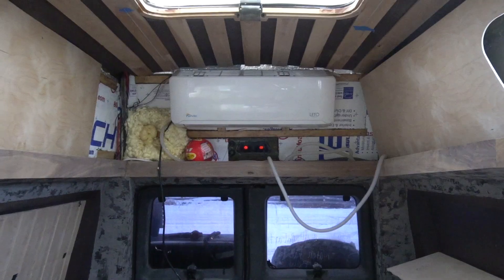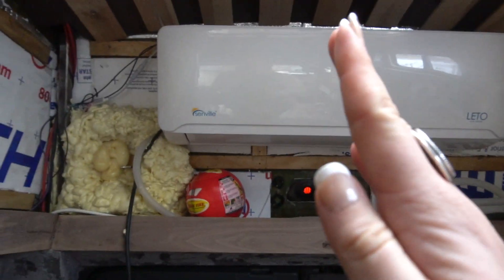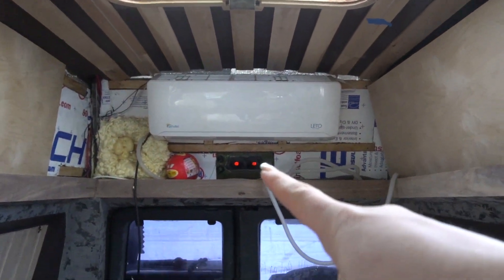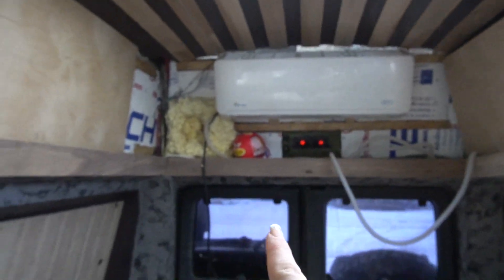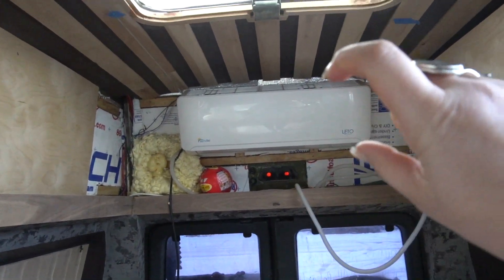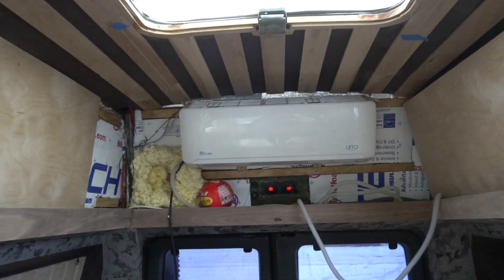Before adding the solar panel on top, Lance has to do some fixing on some other things. If you can see here, the mini split is not straight up and down — it's actually angled a bit because the back of our van is angled. Which means that when the condensation is supposed to go in the little tube, it's not catching in the tray because it's angled down, so it's just dripping in all of our stuff. So we have to move it, straighten it out, and then we can add that solar panel.